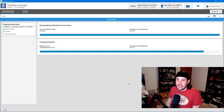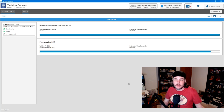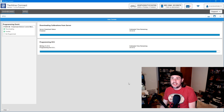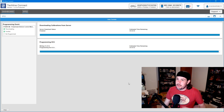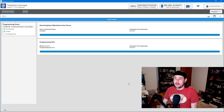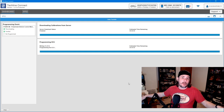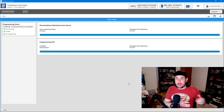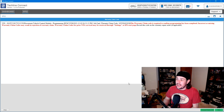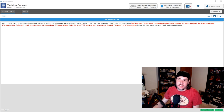He can go in and go through the tuning process. He's wanting to learn the tuning process anyways. Starting from stock a lot of times is a lot easier, but whenever you can't even get into it, sometimes this is a good option. Granted, you could probably just go ahead and overwrite the thing, but this also gives you the opportunity that if you need to go back to the ECU that had the tune that he paid for, he can just swap over to it, because you can't download that tune. You can't do anything like that. And so if he were to overwrite it, that tune would be lost.